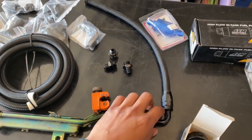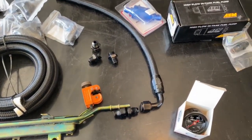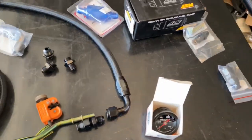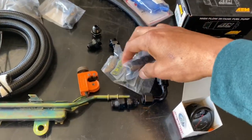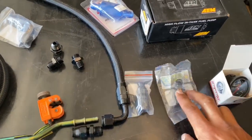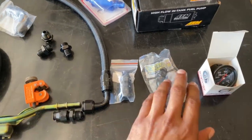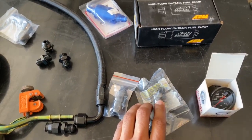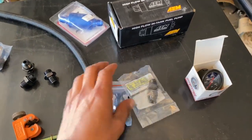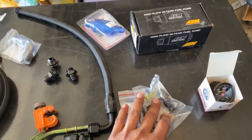I'm not gonna use that mock-up because I need it a bit longer. For my return and my feed, I got the same type of fitting — a pressure fitting, 5/16ths and 1/4 for the return. On the return you don't have to use a pressure fitting because it's not a high-pressure line, it's just a return line, but I wanted it to match up and look nice with the rest of the fittings. It's only about $10 for the fitting.